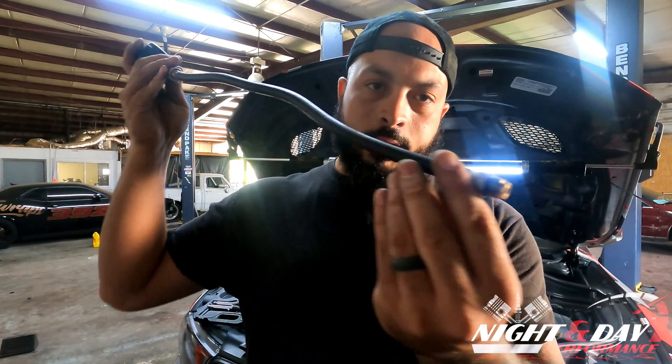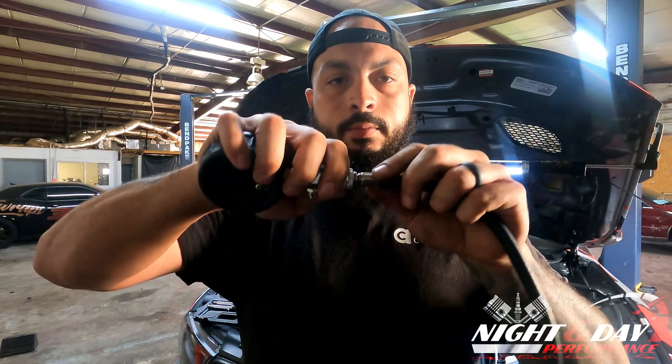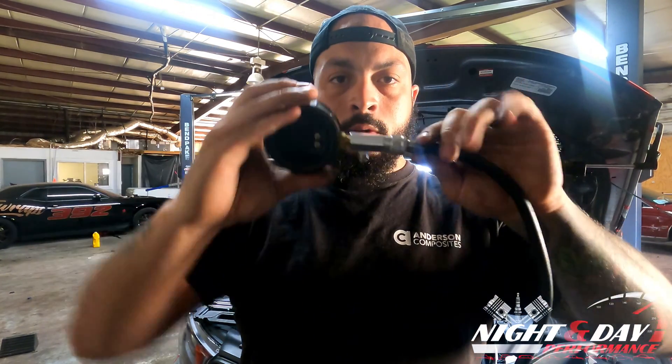What we're going to do is go into the fuse box on the vehicle. You're going to want to pull the fuses for the fuel pump and/or the fuel injectors. You want to disconnect any coil packs or anything like that, because you don't want the car to start with the conditions we're going to create. Then you're going to actually thread this portion down in where your spark plug hole is. This portion is disconnected from the gauge. You're going to connect the gauge and actually start the car — if you have a push button, just push the button, or turn the key. We're going to listen for two to three rotations of the engine to make sure it has a full cycle.